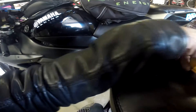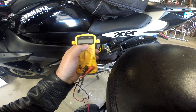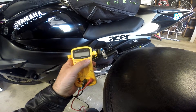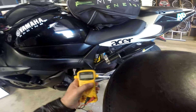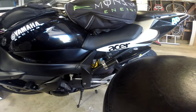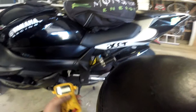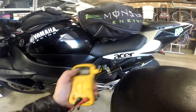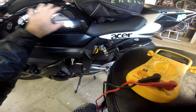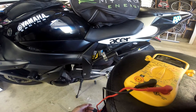If you're doing this test and you're noticing that when you rev the motor the volts are just going up a little bit, try to replace your rectifier first — because that was happening to me. It can't be the stator because it is producing voltage, it's just not going up enough. I strongly suggest you get an ElectroSport stator or ElectroSport rectifier. They have those for every brand of motorcycle practically. The ElectroSport stator, if it ends up being your stator, produces more output than even the OEM stator that comes with your motorcycle — especially for this Yamaha R1.